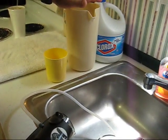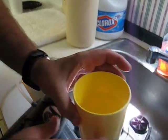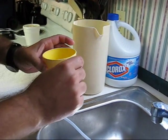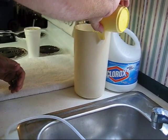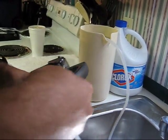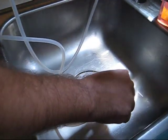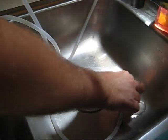What we have here is just a pitcher of water, about half a gallon. And we have a juice glass about half full — I'm going to say four ounces of Clorox unscented regular bleach. I'm not going to play scientist and say you only need a couple ounces of bleach to do this job. What we're going to do is cycle the bleach solution through it. I've got the bottom of the water filter down there in case any bacteria has gotten inside, to make sure I'm spraying that down with the bleach solution as well. That is sure to kill anything in there.